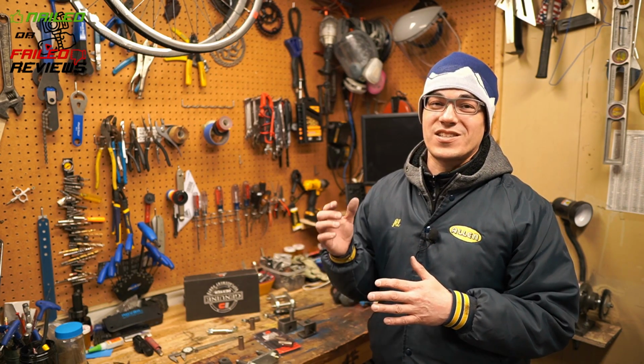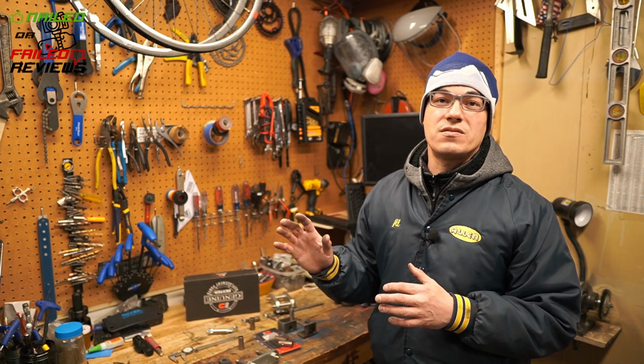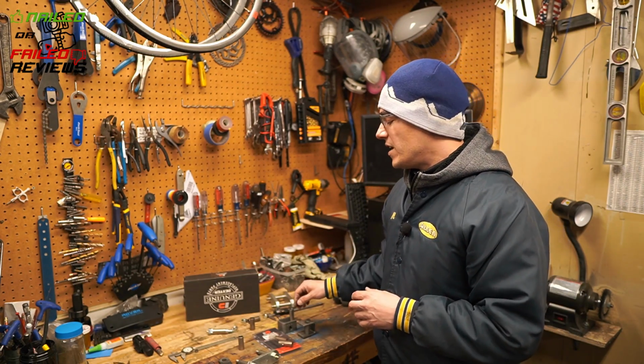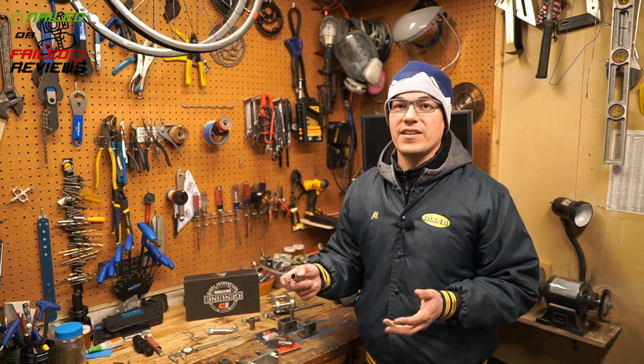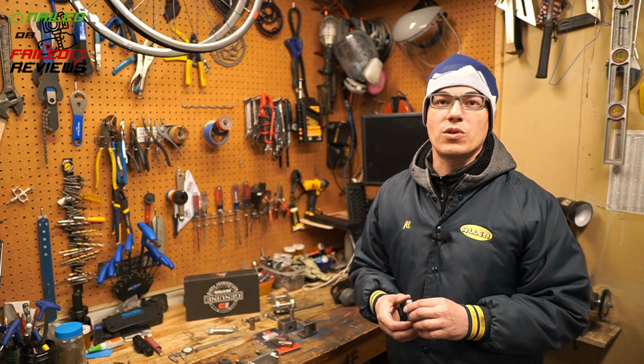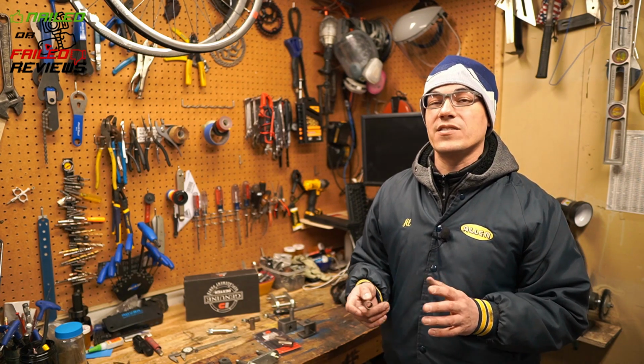Again, I don't have a welder, so what I'm going to do is, my press fit is barely a press fit into there. I can do it by hand, and I'm just going to tack some JB Weld onto there and hope that it holds. I've seen JB Weld used on other projects by people for a lot of crazier things, and it's worked out fine. So I'm hoping that it'll just hold this bushing inside of my shackle just perfectly fine, and then there won't be an issue. I already set it up on one side of the trailer to make sure it would work properly, and it looks like it's going to be just fine.